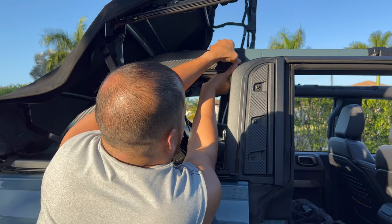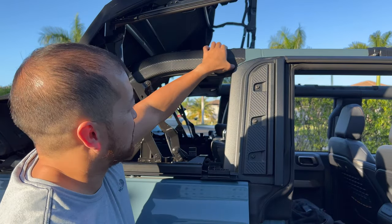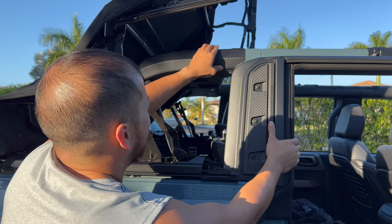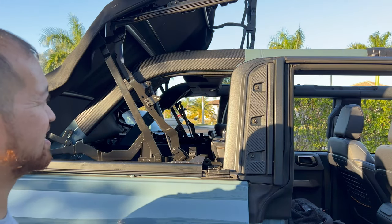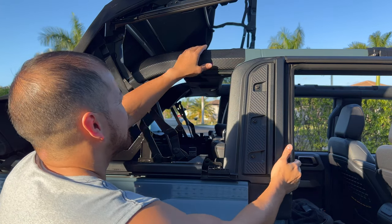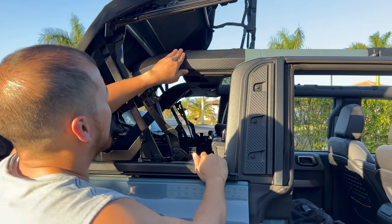The area towards the front seems to pull up a lot of water and is sometimes hard to get down. It's probably 70-some degrees right now in North Fort Myers. For those of you up north trying to install these outdoors or in heated garages, you won't get as warm as I am. Those are the times where you need to get everything nice and warm — vinyl becomes brittle and handles very differently when it's too cold. The same can be said when it's too warm: above 80 degrees in direct sunlight, it would be really easy to over-stretch the vinyl. So if it's really hot, keep it in the shade; if it's really cold, keep it warm.